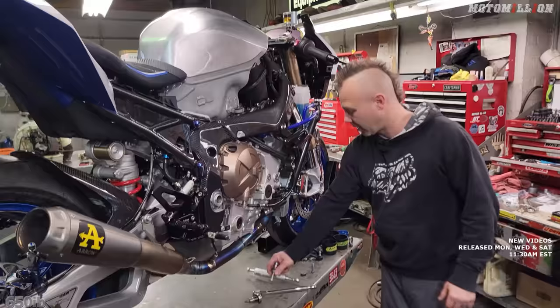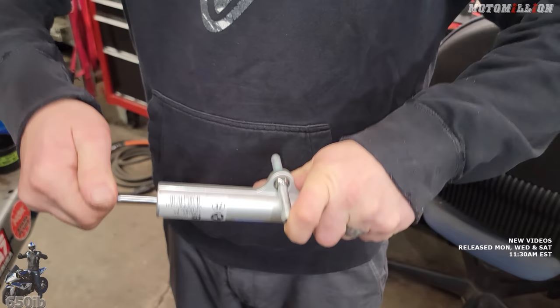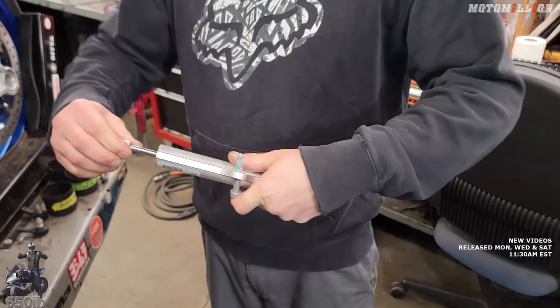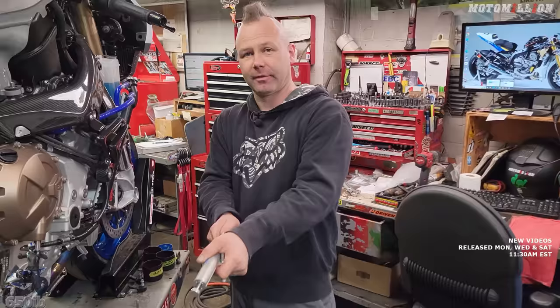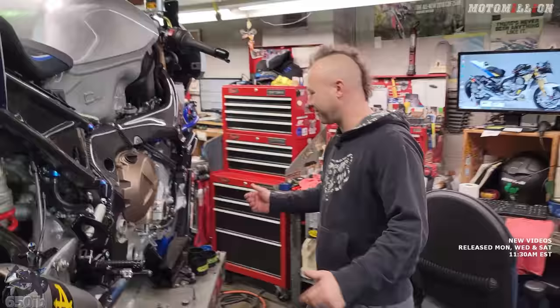I got the stock damper off. Like I said, we've covered it in other videos. This is how you adjust it — this one has about 10 clicks or so and the Ohlins has 20. When it's stiff, it's hard to move back — that's what's keeping your front wheel from shaking the handlebars — and when you put it on soft, it's a lot easier to move. Hopefully you can see I'm struggling less. I do pay attention to your videos.